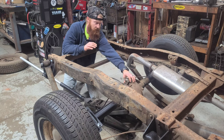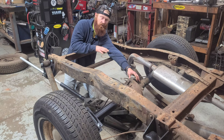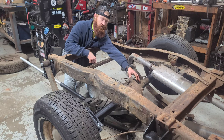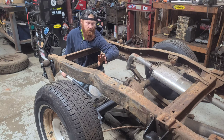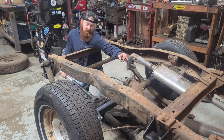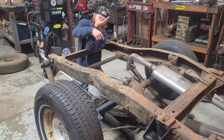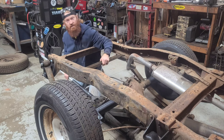You can see right here the pinion is pointing straight down, which is not what you want. I'm going to have to get a different bite on the rear end so it doesn't walk out of the transmission. The driveshaft is now starting to lift with the truck, which is what you want — you don't want to keep jacking that pinion angle until it slips out. What I ended up doing was wedging the front part of the jack so the rear end is basically at a taper, counteracting that rotation. Let's get this thing back up.